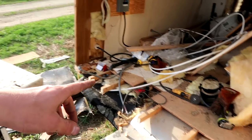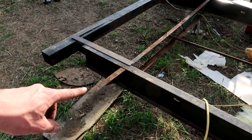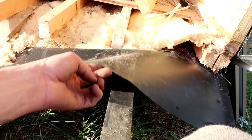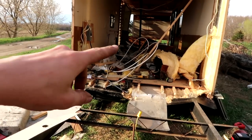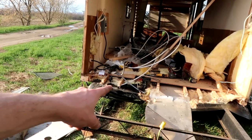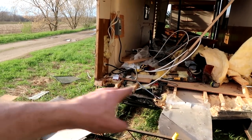I'd like this camper to not only work for Crush, but for four-wheelers, dirt bikes, and maybe even cars — though it won't work with the Jeep. The Jeep's probably eight feet tall and this only has a seven-foot ceiling. But you machine freaks in the comment section saying this is a park model — I do now believe you. There are only a few places on the frame where the boards get bolted down, and the floor joists don't even sit on the frame evenly. Only about half an inch of that joist is on this frame. So before this officially becomes the crush carrier, we have to beef up the floor — rip all that 5/8 plywood out and formulate a very solid foundation. That's not acceptable. The 5/8 plywood is good but you need a solid foundation — you can't just start throwing plywood on stuff.